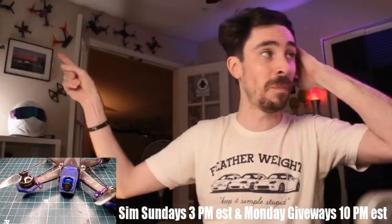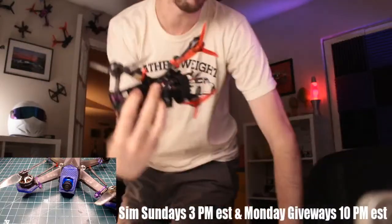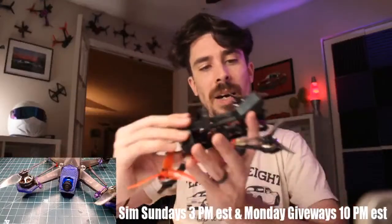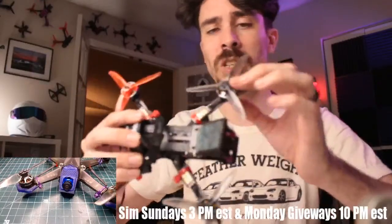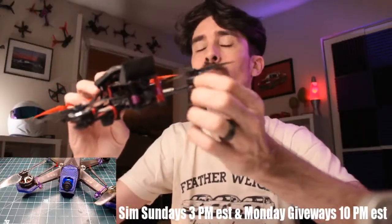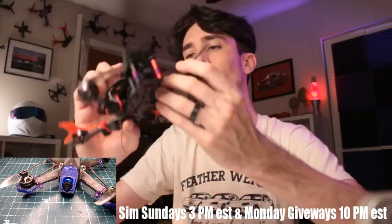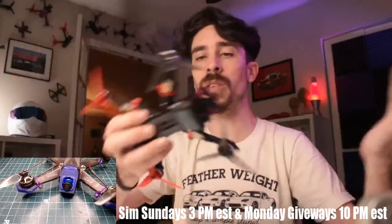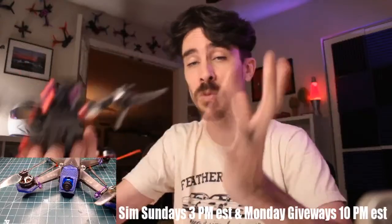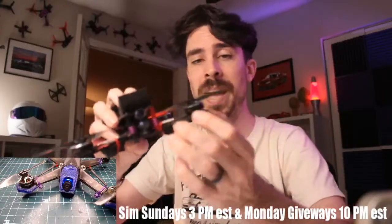Yeah, the 4-inch rig that I've been playing around with is basically a prototype 4-ride. And it flies really good. I have some footage on the memory card that's in here of doing some tuning stuff just to get a feel for these Brother Hobby 2004s, and oh my god, they're just beautiful. They are so smooth. On any kind of micros or anything bigger or smaller than 5-inch, it's really important to have motors that are smooth when you spin them by hand, if you want something that's going to be smooth for freestyle and not have jello or any bullshit, and you can put a really good tune on it that looks good for cinematic type shit.